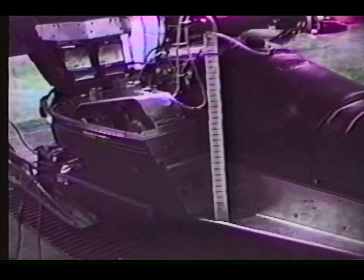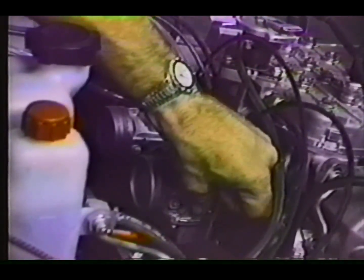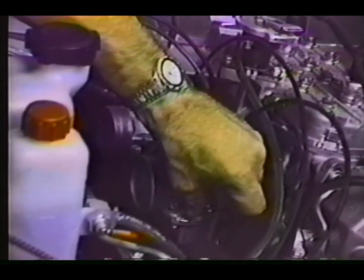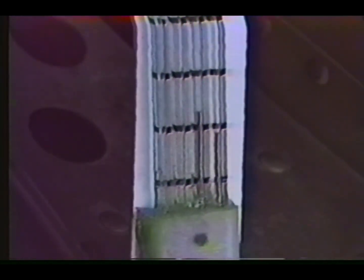Start the engine, allow it to warm up, and for the idle to stabilize. A high mercury column indicates high vacuum or a low throttle slide. Adjust each idle screw until the columns of mercury are equal in height. Now refer to the service manual for the correct idle RPM on the model you are working on. Apply slight thumb pressure to the throttle. Turn the cable adjusters until the columns of mercury are again equal. After this is done, recheck throttle lever free play.